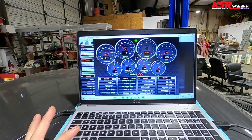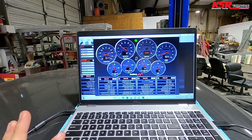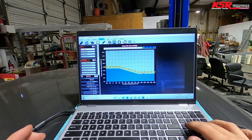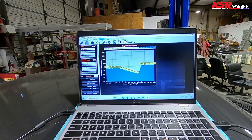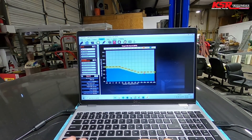We'll fix that in a minute. Once the engine is fully warmed up, the IAC should be less than 10% — I usually aim for around 5%. To verify the IAC is working, go back to idle speed and tell it we want 1500 RPM. It's now trying to figure out where it needs to be — and it's working. We know our idle air control motor is functioning.